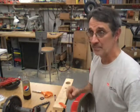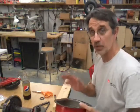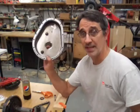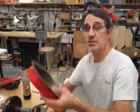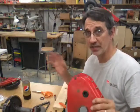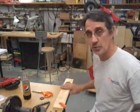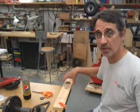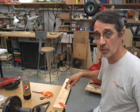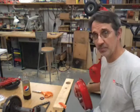I don't know what your weather is like where you live, but my yard is just about full of leaves. Luckily my boss's isn't, so we got to get this together for him. You got your rear pan or your differential pan, and as you can see I welded the hole shut — for some reason they have holes in these. Here's the board I use — just a strip of plywood with a two-inch hole and a three-quarter-inch hole.